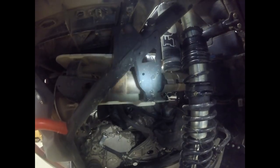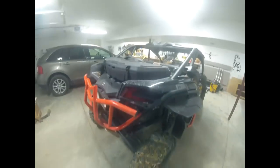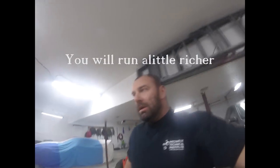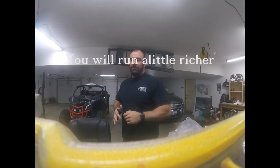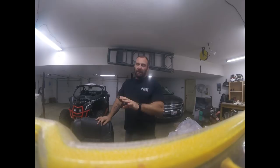You can see there's the opening connected into your exhaust. All you have to do is take this off, take a long chisel and hammer and go to town on it. What's inside is actually quite expensive — you can take it to a salvage yard and get some money for it. It's very soft and easy to get out, so all you're going to do is chisel that out and then you have a cat delete system. Taking that catalytic converter out and putting on a blow-off valve is not going to mess with your computer whatsoever — you're not going to throw any codes.